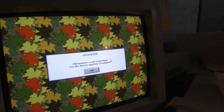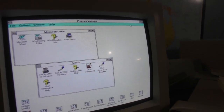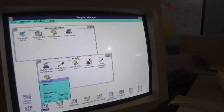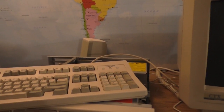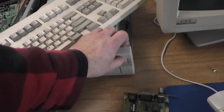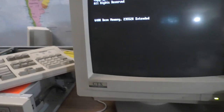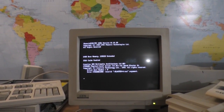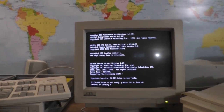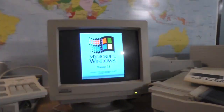It'll still run fine but it'll basically be a downgrade from what it was. Sound Blaster's not there — that's fine. We still have the video artifacts, so I've got some bad video memory for sure. The question is which module it is. We still got those artifacts. I think I can pull all four of these out — let's do that and see what that did for us. So now this is basically set up as it was from the factory without any upgrades, and we're going to find out if we have a problem with the onboard.